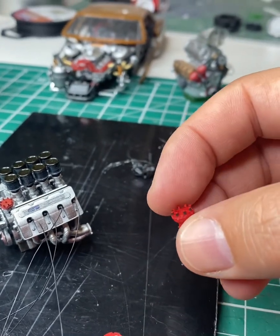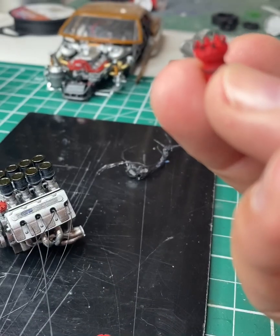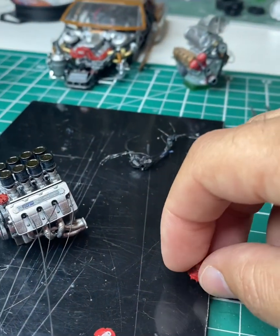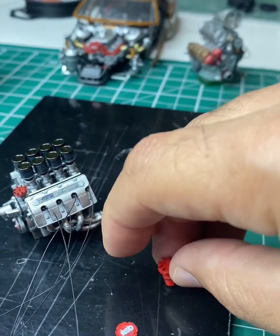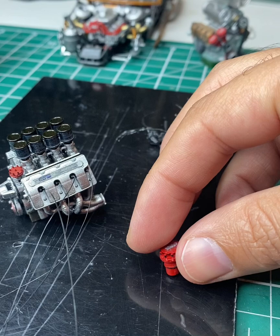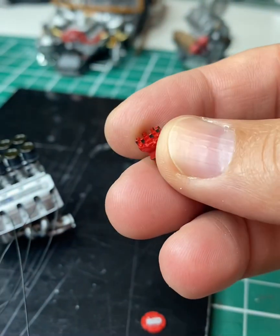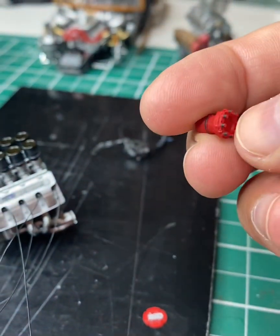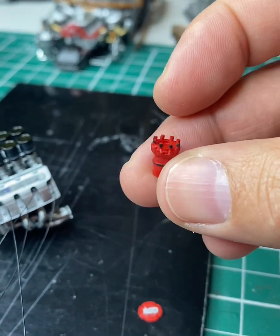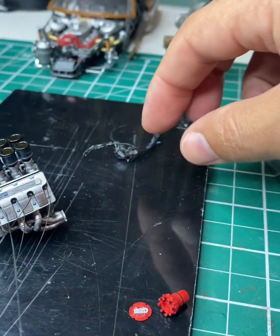So this is about a top fuel sized distributor. What you can see is there's the base, the main body of the distributor, and then the elements that pop up. The second piece is just a lid — an MSD branded lid — and one glues on top of the other. The reason I did that is to try and pass wires in between these spokes from one side of the engine to the other, so instead of having to wire things individually, it became a fast process.